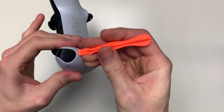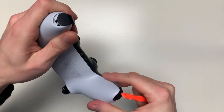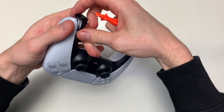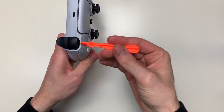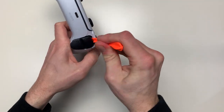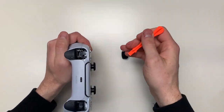As the first step you have to make sure that the black cover comes off first. That's quite simple by first detaching it at the bottom with the pry tool. Once it's loose you can just go gently back and forth and take it off the controller. Next, detach both of the triggers using the pry tool — put the pry tool in at the side of the controller, then flip it back and forth and the trigger will come off easily.